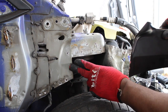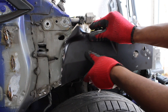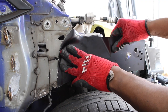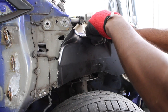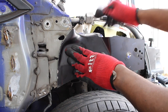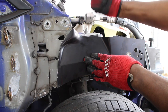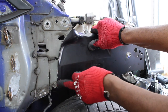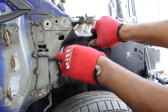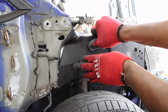So we've cut the piece now. What we've done is hammered it down so it's sitting firm against the back — we're going to put a little spot weld there and give it a sand to get it flush. Then this piece here will go on top like that, and as you can see this bit fits absolutely flush, covering up the original joins at the top here. So we know it's dead straight and sitting right inside this aperture. We'll do a couple of holes here to secure it to the strut, seal this bit here, and first of all I'm going to clean this up so we've got a good earth when we start welding.